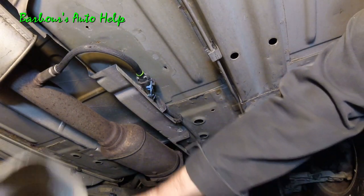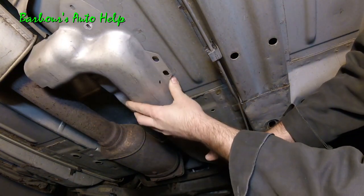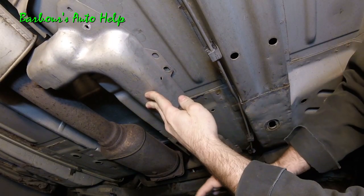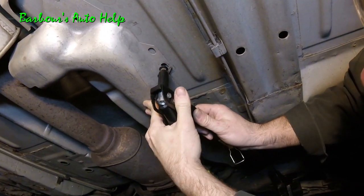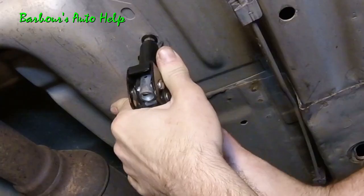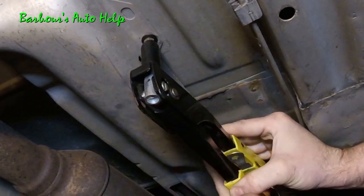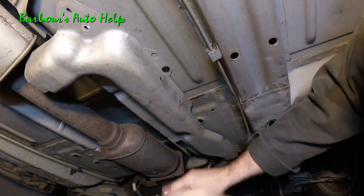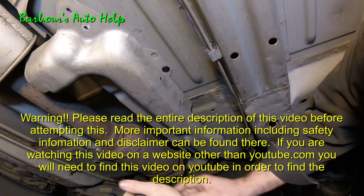And we're going to place our shield back up into place, just like so. And we're going to make sure all of our rivet holes line up before we start riveting. All right, so all of our rivet holes are lined up. We're going to go ahead and place our rivet inside the hole there, and go ahead and rivet it. When it gets to the end, it'll pop off, just like that. And same thing for your other 3. Repeat that process for your other 3 rivet holes.